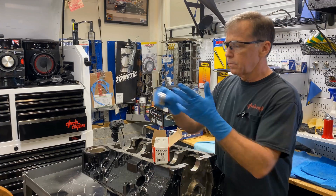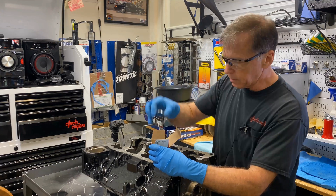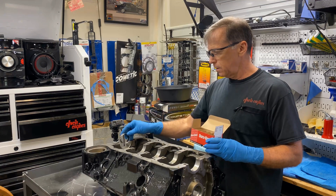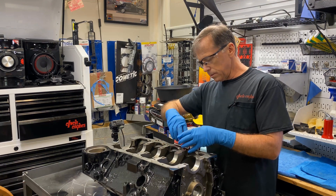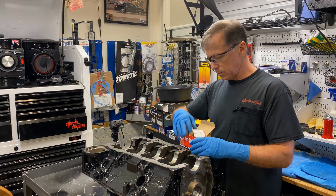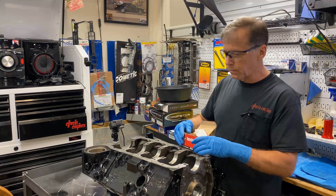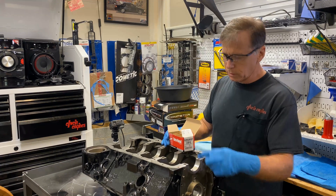So if you want to know, you just grab one at random from the box. This one is a CHP 4-2. This bearing will only go in wherever 4-2 says it goes — it'll go in the two position or the five position. The next one here says it's a 4-3 — that'll go in the three or the four position. Of course, there'll be two of those. Here's a 4-3. This one here is a 4-2 — that'll go in the two or the five position. And this one is a 4-1 — that'll go in the one position.